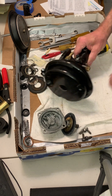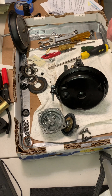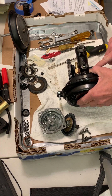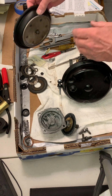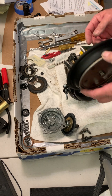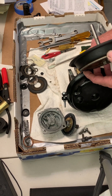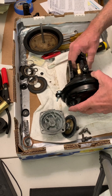I had this thing apart and been looking at it, thinking about how it must operate, so I thought I'd explain how I think this thing works in case anybody's been curious. Essentially, this part is a master cylinder, and instead of your foot pushing a pedal, this rod is the equivalent of the push rod a regular master cylinder would have. It pushes the piston in here, it's full of fluid, comes out here and goes to your brakes — just like a master cylinder.